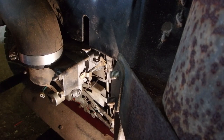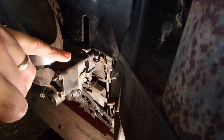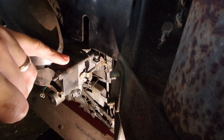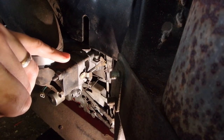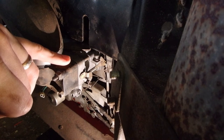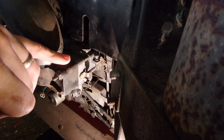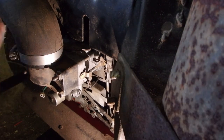Carburetor is cleaned out with new o-rings and gaskets, so it should run much better. One of the high-speed jets when I was cleaning out was plugged up, so I know that's what was causing it to run bad. It idled great but it definitely ran pretty good until you put a load on it when you engaged the mower deck - you could tell it was kind of down on power. This should take care of that. Thanks for watching - leave a comment down below, hit the like button, and subscribe for more.